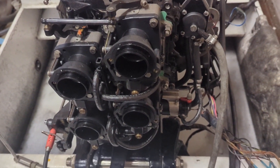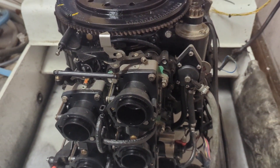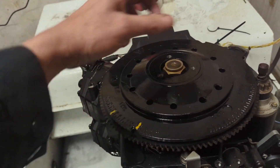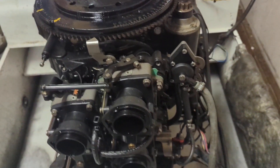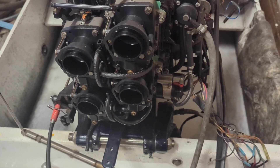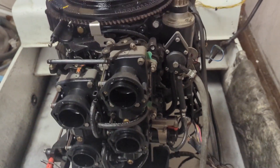This bypass was also designed for starting with a rope if you have a dead battery out on the ocean. Most motors supply a rope — there's a little hook, and you can actually start up to a 200 horsepower motor with a rope. When you're stuck out in the bay and desperate, you're probably going to try it.